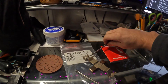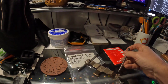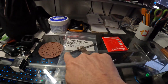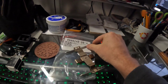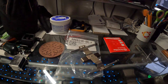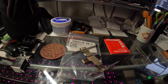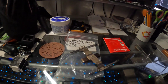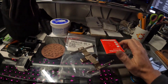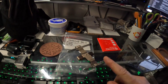These pins go through the hardware which holds the brake pads in place. That back chunk would not come unseized — we used a torch and even the acetone and ATF 50/50 mix soaked for a good hour, and it did not help at all. Just be aware: if you let your brakes go unserviced — I hadn't done a brake service in four years — I don't know if this was a flaw or not, but the top pin would not come out. The bottom pin came out fine, but not the top pin.